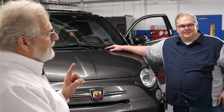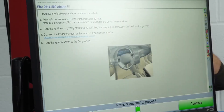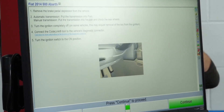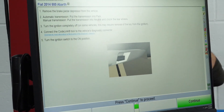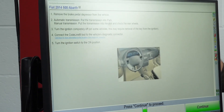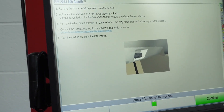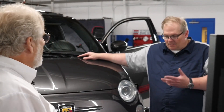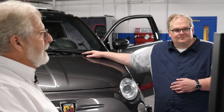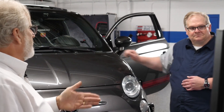Not quite. One last step we need to do is reset the SAS — it could be for EPS or for stability control, whatever the case may be. We're going to follow the manufacturer's process. First, we're going to remove the brake pedal depressor. If it's an automatic transmission, place it in park; if manual, place it in neutral. After that, we're going to connect the scan tool to the OBD2 connector, then turn the key to the on position. Once I do that, I can actually control the aligner through the scan tool and go through the process without going back and forth.